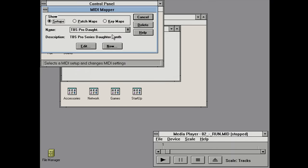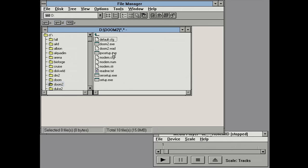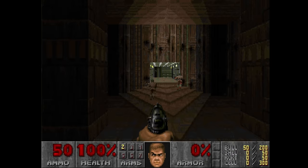The same goes for MIDI modules. You have to set it to external and MIDI interface used. You can use it to listen to MIDI files, to compose music, play Windows games, whatever. The issue is, there's no way, at least I haven't found one, to set it up in DOS. DOS always uses internal General MIDI set no matter what I tried.